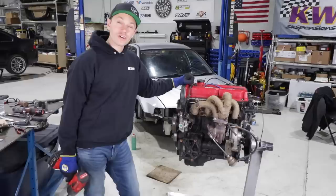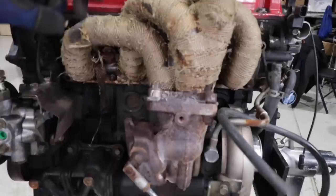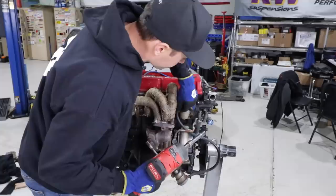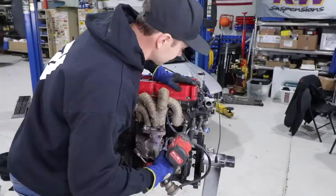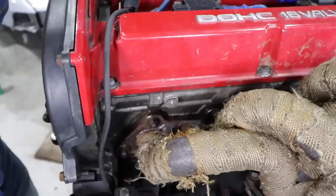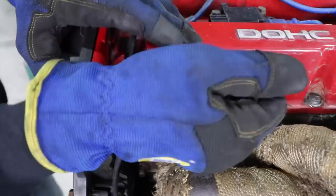It is nice to have this engine on an engine stand so we can finally get to some serious work. We're going to start by removing the manifold and turbo setup. It is very rusty and grungy — I think this car had one hell of an exhaust leak. This gasket here is absolutely destroyed. I did soak these the other day, so they have been soaking for about 24 hours. I'm going to start off with the big bolt, the 14 mil on the side here. This should crack off pretty easily — success.